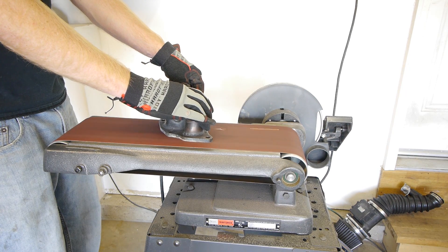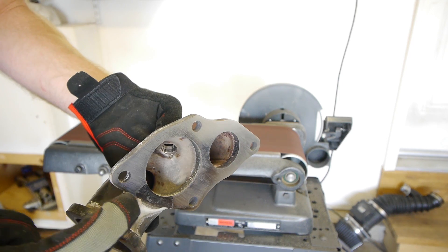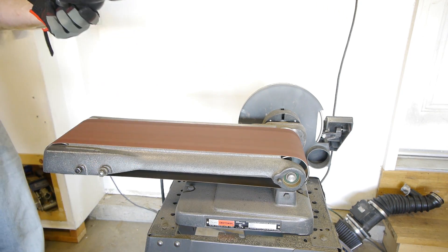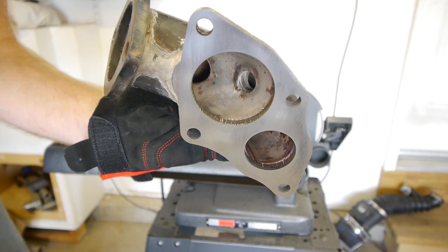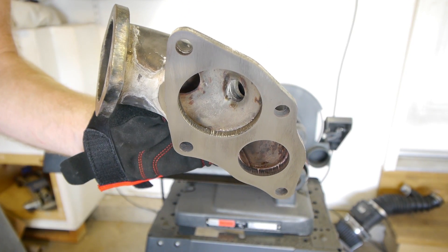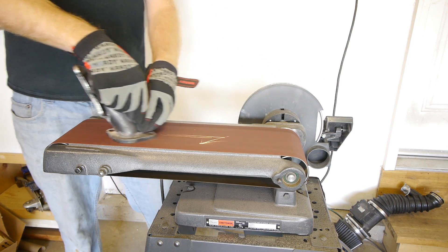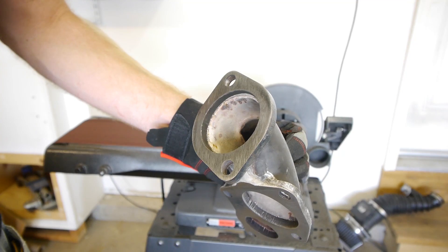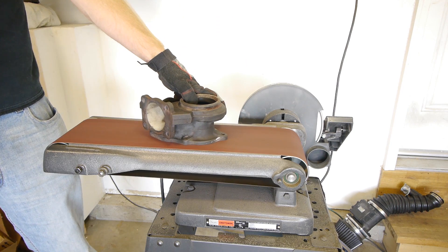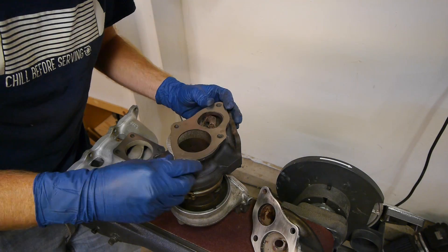The biggest problem area was along the bottom. You can clearly see the evidence of exhaust exiting where it shouldn't be. I worked on flattening out this section for like a good 10 minutes before it was completely smooth. Finally, nice and flat. Look at how much extra surface area was sticking out where it shouldn't have been. I'm stoked to finally have this flat. And at least the downpipe flange was nice and flat - that took all of 10 seconds to do. I also did the turbine housing, which only had a few small issues. That looks perfect. Let's get this thing reassembled.